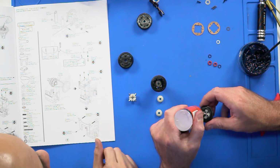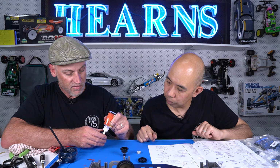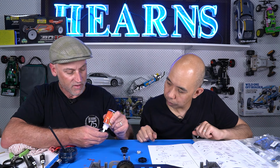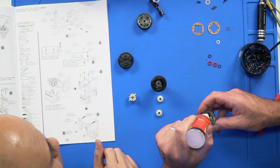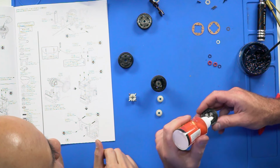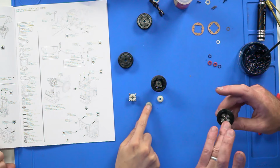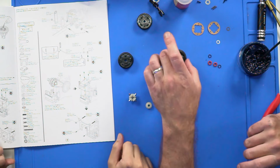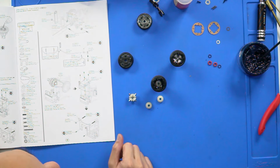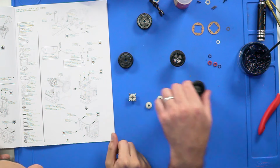And again, I'm going to go ahead and put another lot of oil. As a rule of thumb, if it doesn't give a weight or a specification where to fill it up, you probably just want to cover the cross pins. Because once the bigger bevel goes in, it's going to be displacing some more fluid, right? That's right. Okay, so up to the cross pins it is at the moment? Yep, just up to the cross pins I think is a very good general rule.